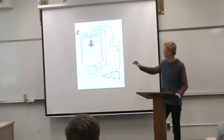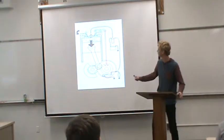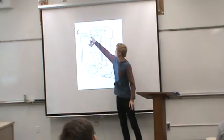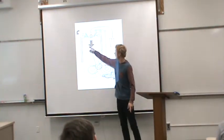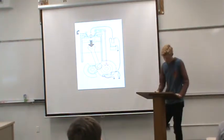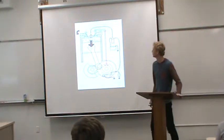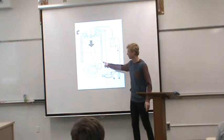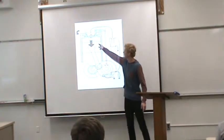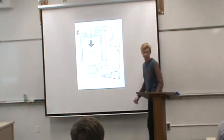This is pretty much a basic diagram of a 4-stroke engine. Before I go into too much detail, I just want to tell you some vocabulary. This is going to be your spark plug, this is your piston, and then these are valves. Matt Finley explains in his article, Animated Images, that during the intake stroke, the piston moves downward, drawing in a fresh charge of vaporized fuel and air mixture. So basically, these gears are just going to be rotating while the motorcycle's on, and the piston's going to come down, and the gas and air is just going to come through here and fill up that area.